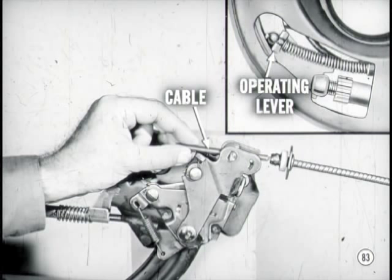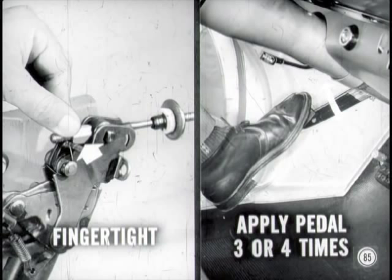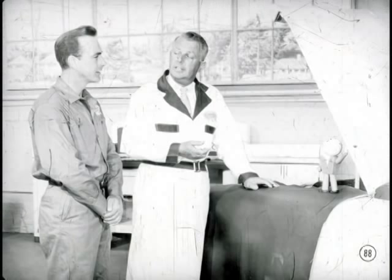Now here's a revision in the internal expanding brake cable adjusting procedure. First, install the cable and then pull it firmly from the top with a force of approximately five to nine pounds to take up the slack. Then install the cable adjusting nut, but leave it loose enough so that the brake operating lever is in the fully released position. Then use this new tool to adjust the shoes until a slight drag is felt. Back off the adjustment one notch or until the drum is free. Next, turn up the cable adjusting nut finger tight. Then apply the pedal three or four times to eliminate all slack from the cable. After that, re-tighten the nut finger tight, and finally add three full turns with a wrench. Complete the cable adjustment by testing the brake pedal travel — this should be no more than three and one-half inches with nominal foot pressure. If you hear five or six clicks from the pedal as you press it down, you'll know you've got the right adjustment.